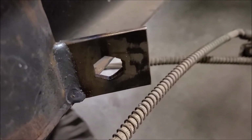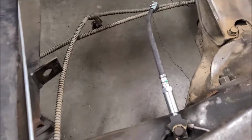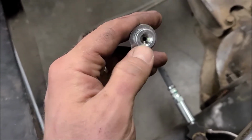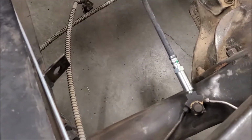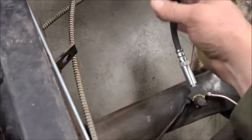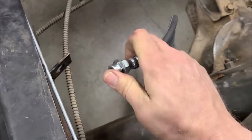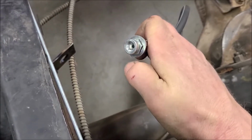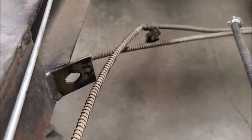It just took a little bit of time to get that to fit correctly, and that'll keep that hose from wanting to spin the nut on the hard line, or have the hard line try to spin inside here, where it mates to the sealing surface. So I would recommend making sure that both ends are secure like that. Front's the same way, except it was round with just a little tab sticking out the bottom, so that was easier to notch out with a file. I think I used the body saw for that. Cutting a whole nut shape in that tab was kind of a pain.